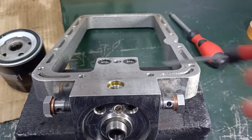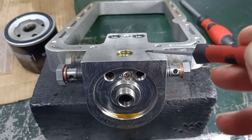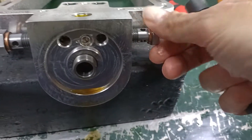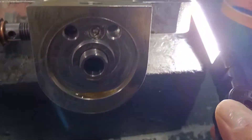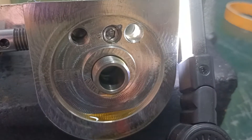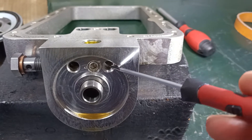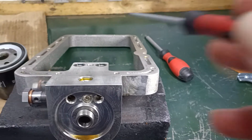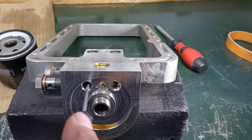Once you take this blanking plug out, oil is forced down there, out of here and out of there, because this is the same drilling. You can see where the light's coming in — they should all come through here, into the filter, out of there, through the hose, through the oil cooler, back through this hose. This casting is purely an L-shape: it goes in and then it goes out to there.